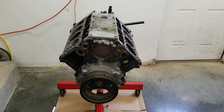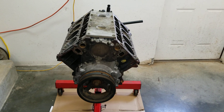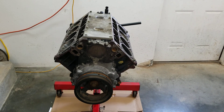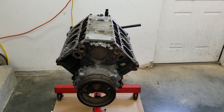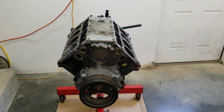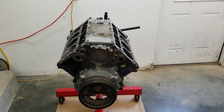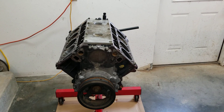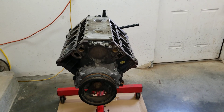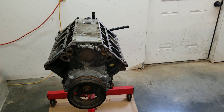Don't get me started on the Ford stuff — that's just an abomination. They like mid-year changes, swapping cylinder numbers in the middle of a year, swapping firing orders. The firing order on these LS engines is different from a small block Chevrolet, big block Chevrolet, or even Mopars. Mopars and Chevys are the same: 1-8-4-3-6-5-7-2 is your firing order. I honestly don't know what it is on the LS — it's on the computer, I don't worry about it.